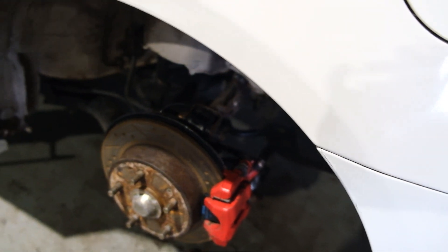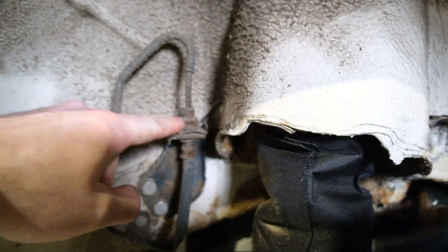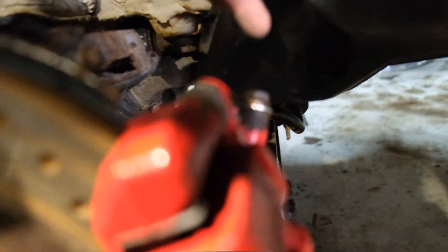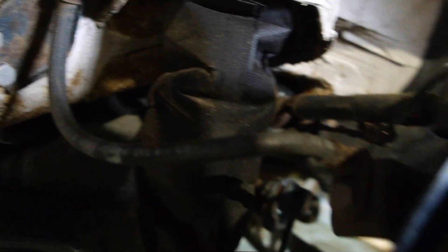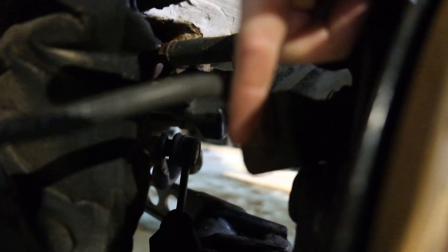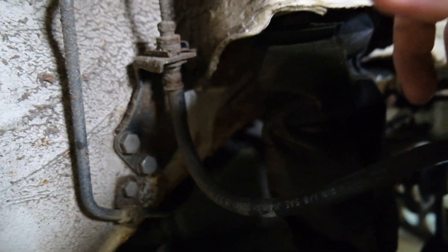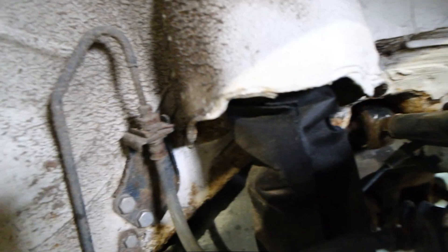So to begin, if we just have a look down here — we can see this is where it will come off from. This is the section here, and then down here all the way to the back of the brake caliper. We're going to want to get this bolt off on the back behind the hub. This is what holds it on to the bracket, and then we'll be able to take it off this end and that end, get the new one fitted, and then we'll obviously need to bleed it at the end as well.